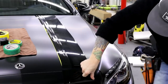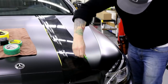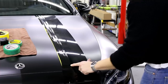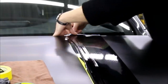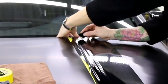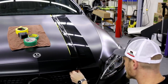When we're going to go over it, we want to come out with our finger or our squeegee — this is how you want to lay down the remainder. Now for the fun part — this is going to be our pinstripe and our black spacing. When it comes to the top, I need to pull all three of these at the same time. Yes, all three are going — I'm going to take all three down all the way, and as I get down under here I'm going to hold it. Now we're going to remove that center section.